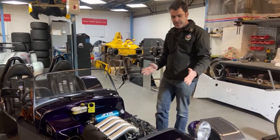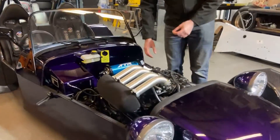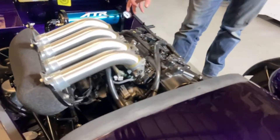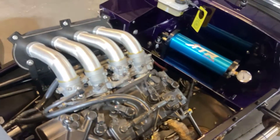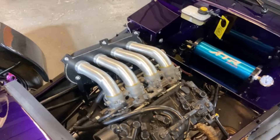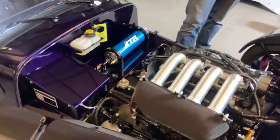We then got our standard Zero chassis, offered the engine up, and we've done a bespoke chassis with all the engine mount actually part of the chassis. So rather than mount it in a cradle or anything, it's actually a structural part of the chassis. It's a lot nicer way of doing it, it's a stiffer way of doing it — it's the right way.